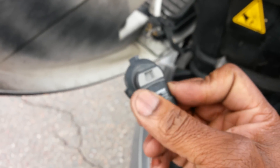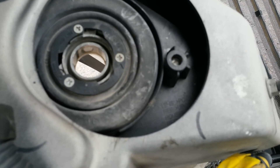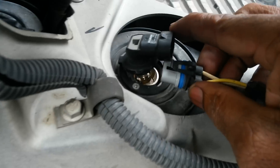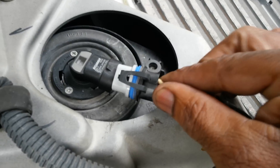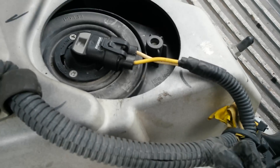Let's just say you wanted to put in a new bulb — this is the same bulb I took off, but let's say it's new. Let me show you the slots. You see how it is? It's got the three slots where you can put the bulb back in, lock it, then take the connector and you hear that fasten. And that's how you change your headlight.